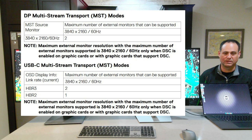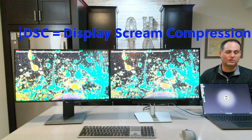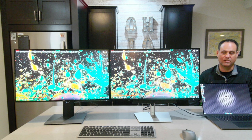However, if you buy a new Dell Latitude or Dell Precision with the new 12th gen Alder Lake processors, within those systems there's something called DSC or Display Stream Compression. That technology in conjunction with MST allows you to run both 4K displays without any degradation to image or refresh rate — so you can do dual 4K at 60Hz. If you have a new system, we can do that. If you don't, you have some limitations when pushing very high-end resolutions.